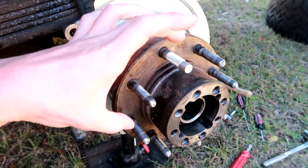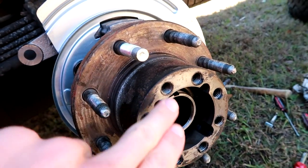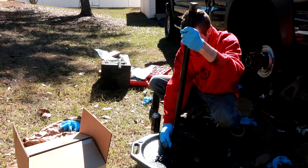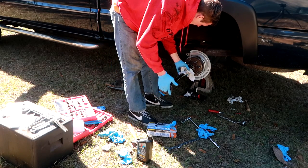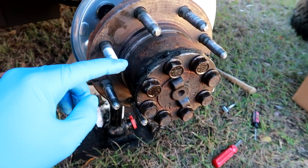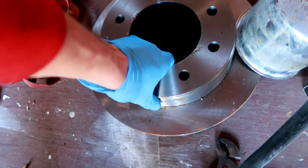It's literally only taken me about seven minutes to put everything back together — that includes my new parking brake anchor. Put the hub back on with the original seal; I cleaned the seal up very well, cleaned up the bearing very well. Now I'm just cleaning this edge, putting silicone on it, then putting everything back together. I got the axle back into the truck, everything's dialed in. All I have to do now is put my caliper on, hook up the brake line, get rid of my makeshift fix, and put the new rotor on instead of that wall hanger. Everything that needed to be done is now done — except I have to bleed the brakes and I need my girlfriend's help for that.